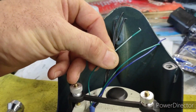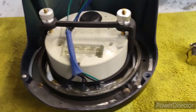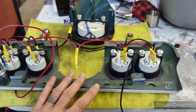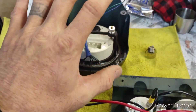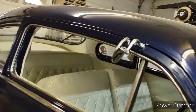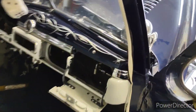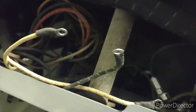In order to make sure I knew which was my left turn and right turn, I marked the green wire with silver — silver is left. So when I put this up inside the dashboard, get this plate screwed on and get it mounted in place, all it is is plug and play. Everything's all done and ready to go, and it keeps things in here as sanitary as it already is.